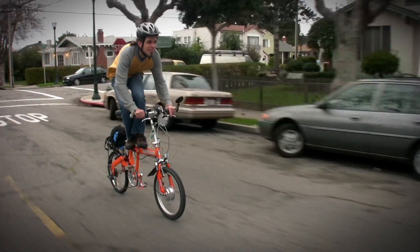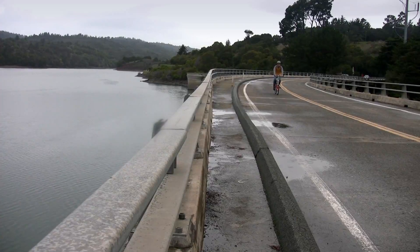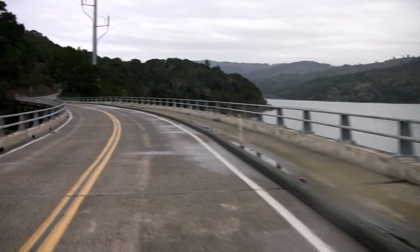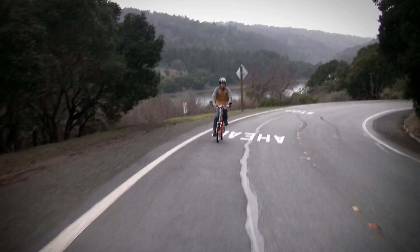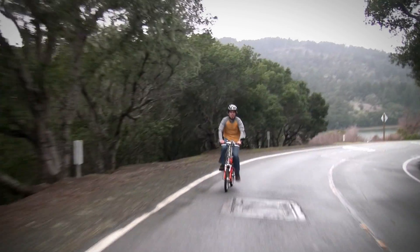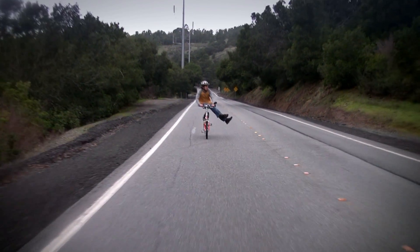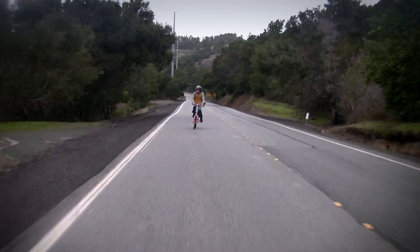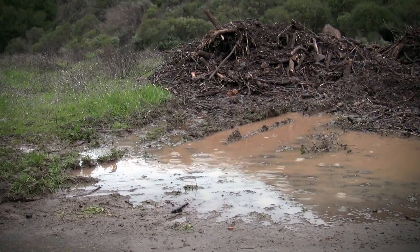Okay, so you can race along at 30 miles per hour on the flat, but what about uphill? Hub motors use a single-speed transmission, so there's always a compromise between top speed and hill climbing performance. This bike aimed somewhere in the middle. On an average grade it's possible to move along without pedaling at all. On steep hills the bike bogs down unless they're short and you can power through them.